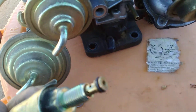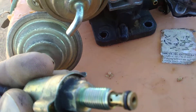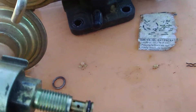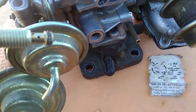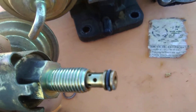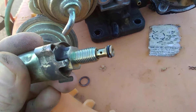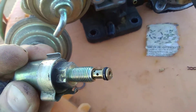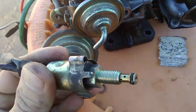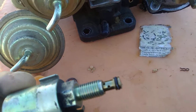If it's not clicking, spray it out with some carburetor cleaner. I recommend some BG Enforce spray or some kind of hardcore penetrating oil — let it soak in for a couple hours, then try tapping on it again. Sometimes you've got to give it a good bump to get it going, but once they come free, they usually work again like brand new. You might have to do it a couple of times over a year or two. If you can't get yours to work, best bet is the junkyard.